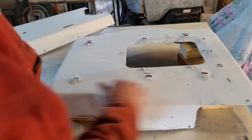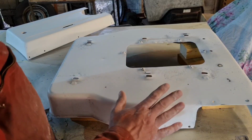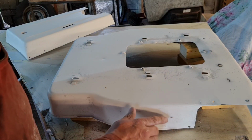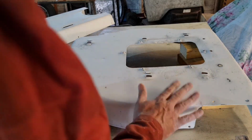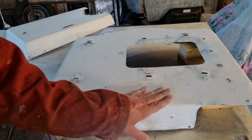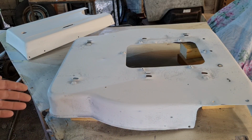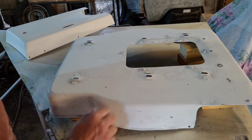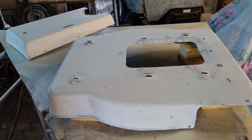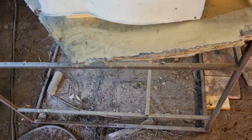So if you have a car sprayed in a spray booth and it's baked on that 20 minute bake cycle, that paint has been forced to dry so quick that the top layer becomes brittle. So it's really, really easy, if you tap it or get a stone chip, for that paint to chip off, because it's been forced to dry far too fast. But with air drying, 2K paint is so durable if it's left to air dry. It's nearly as durable as powder coat. If you put it on right and mix it right, 2K paint is really, really tough. If it's sprayed in an oven and then baked off, it makes it brittle. So that is the downside to spraying in a booth. Have I got a clean environment? No, have I buggery.